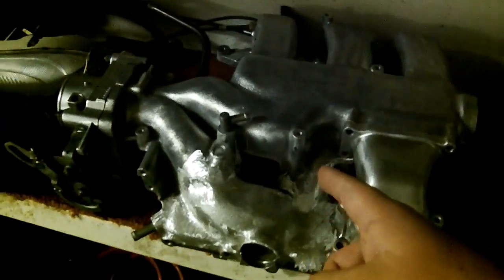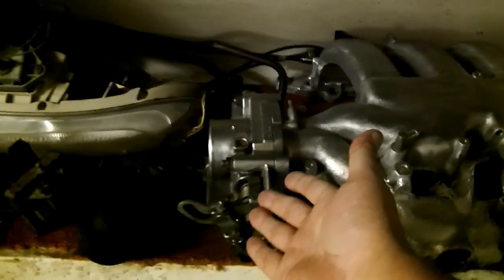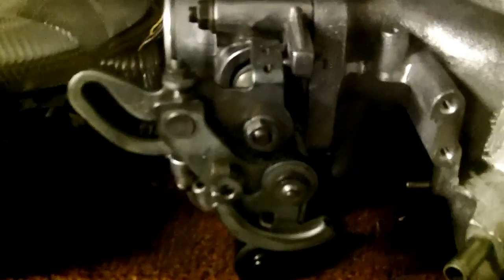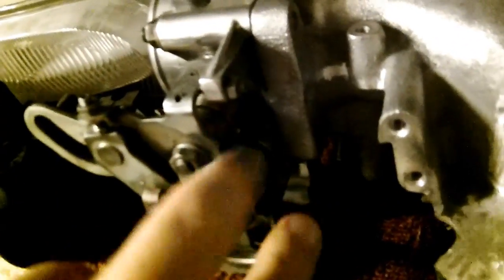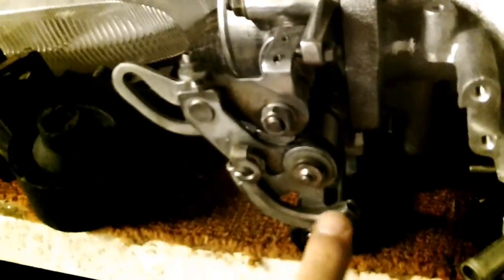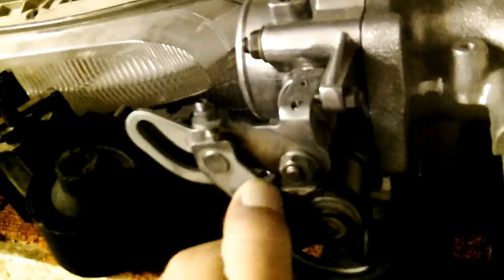This is the KLG-4 manifold. This actually came off a 1998 to 2002 V6 Mazda 626. Here's a throttle body right here, and since this is off the car, I can show you the backside of what the V6 throttle body looks like. The V6 throttle body has this really neat double hinge spring — there are actually two springs, one here and one up here. And as you can see, there are two slides. It's a little bit more complicated than the four-cylinder.